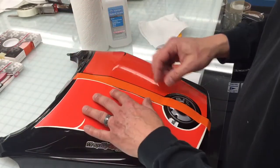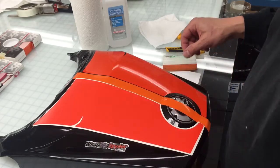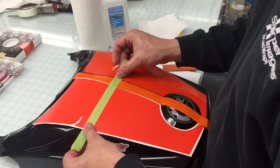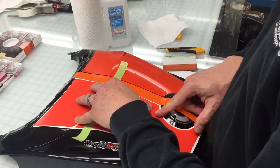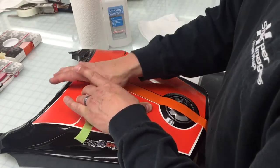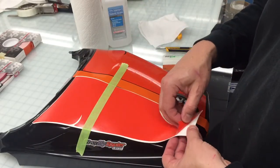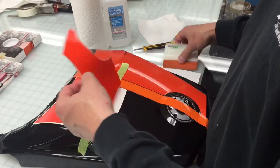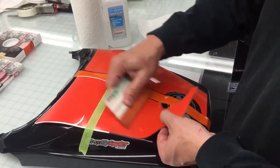Basically, you're going to repeat the same steps on the second side. You want to make sure that your alignment is even from side to side when you're placing the stripe on. Again, we're hinging — first we're going to align and make sure that it's even on both sides. Once you get into position where you like it, we can secure the hinge. The easy side is from middle to bottom, so we'll start there. Hover it in the air, squeegeeing from your hinge down in overlapping strokes.